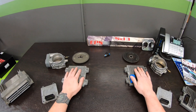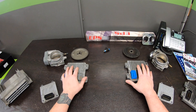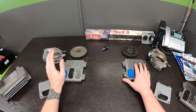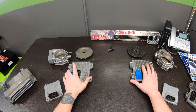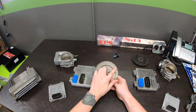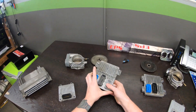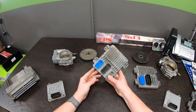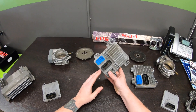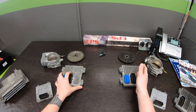Today we're going to talk about LS4 engine control — the electronics behind it and some of the differences between the generations. We'll start with the early LS4, which is 2005 to 2006. Those motors were 24-tooth reluctor on the crank and one-pole on the camshaft sprocket. They used an E40 engine controller, which is the same that's found in the LS2s, and this controller is specific to the 24-tooth reluctor cranks.